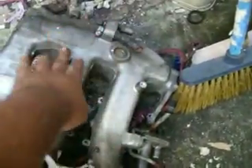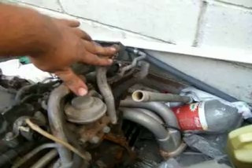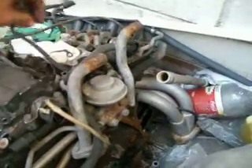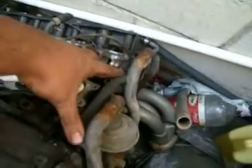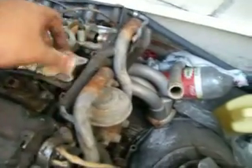These are the water lines that heat up your throttle bodies — they tend to flake. I already took these out from my old twin-turbo plenum, which was bypassed as well. For your NA engine it's a lot easier because you don't have to worry about cooling the turbos. These are the hard pipes that go into the heater core inside your car — this is what heats up the air. Back here there are two tubes; you can cap them off, but the best thing is just to run a hose through them with some pressure clamps.